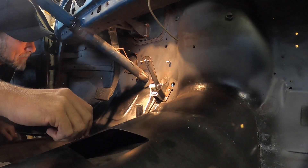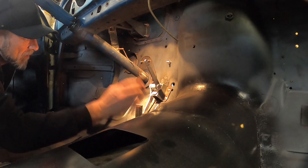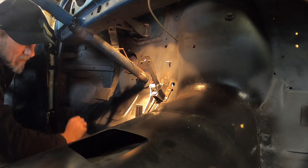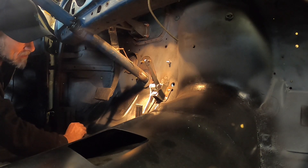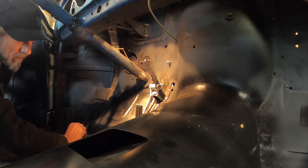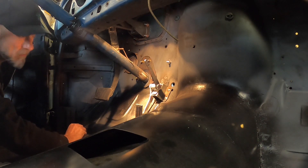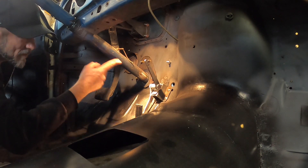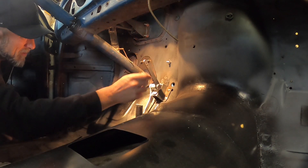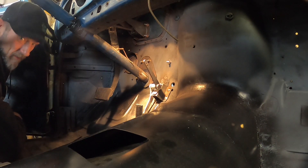The cable's mounted through there — the outer cable. This cable didn't come with any washers so I'll put washers on eventually, but for mock-up purposes I'm not going to for now. I'm just going to get the cable inner, feed it back through, hook the little clevis thing up over here, and then we'll have a little play around at the throttle body and see how that kind of works.